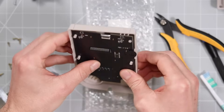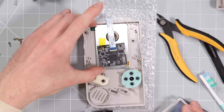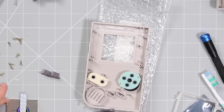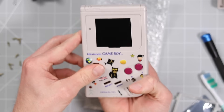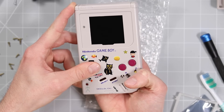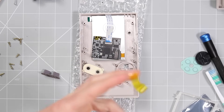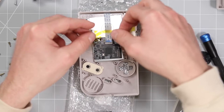So this now sits in there like so, and we now need to put the screen in. Usually it comes with a 3D printed bracket if you order it from Retro Modding. I also have a vague memory of having to cut this little piece for the power switch, so I'm going to go ahead and remove that as well — I think that stops it from being completely centered. It's actually been a while since I've done this, so I'm just kind of remembering how to do it. I'm going to take a little bit of Kapton tape and sit it down on top of the screen like this.